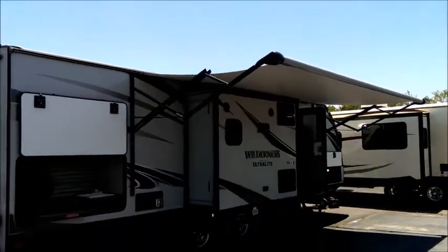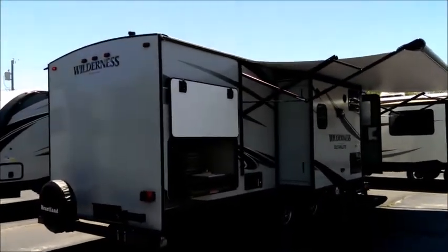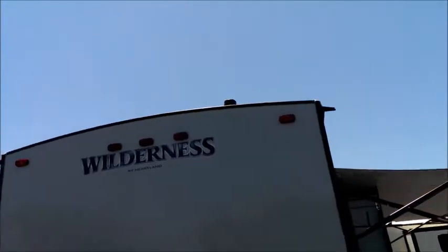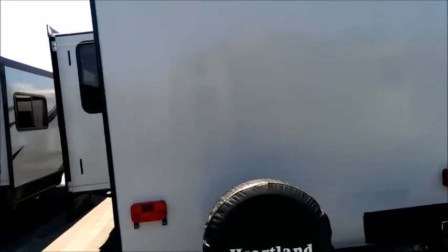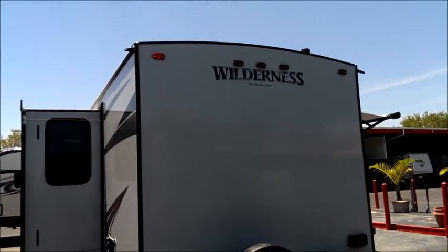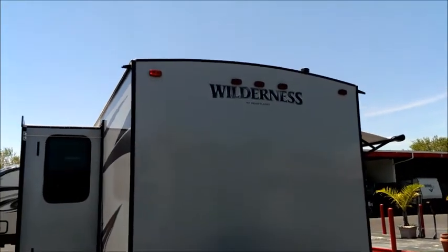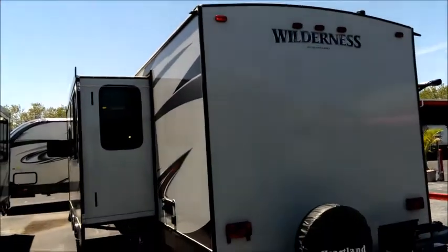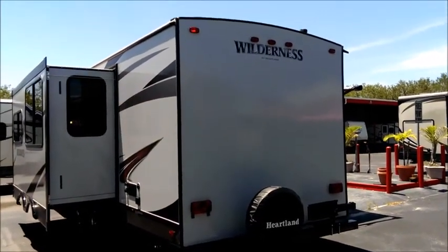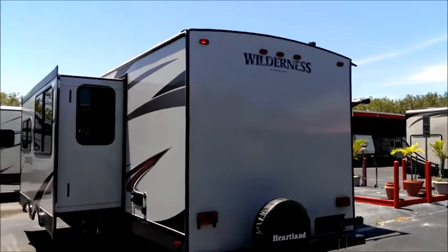Standing back, you can see the real nice crown to the roof with black trim that'll stay looking good with minimal maintenance. Extended spouts shoot water off the side. The roof is fully walk-on, super strong, upgraded construction — aluminum frame, four inch thick foam, crown on top, arch on the inside. It's got TPO material on the roof, which doesn't make the black streaks like traditional rubber roofs. It doesn't require conditioning or treatment, and it has a 12 year warranty.